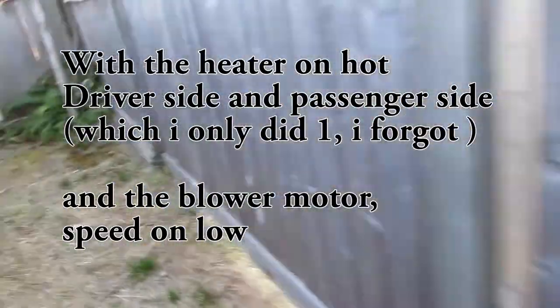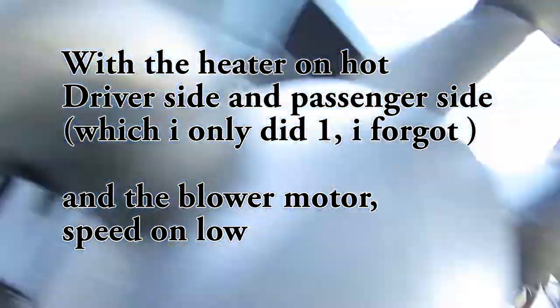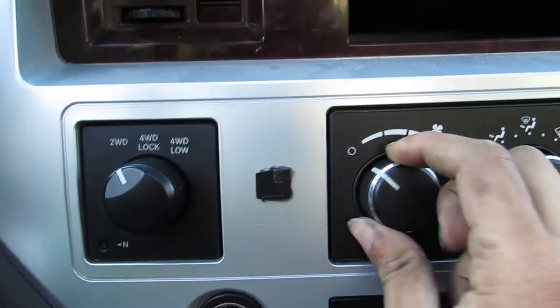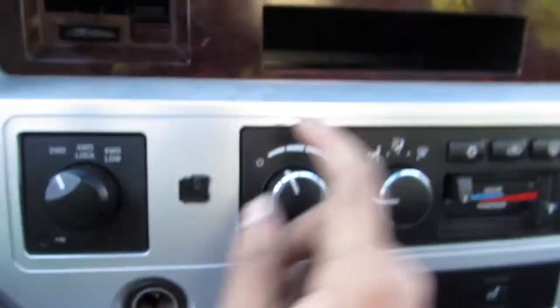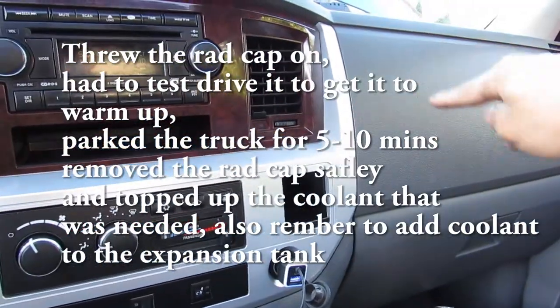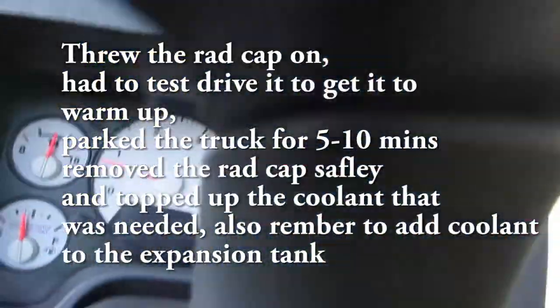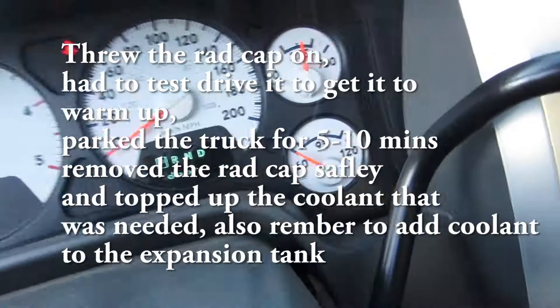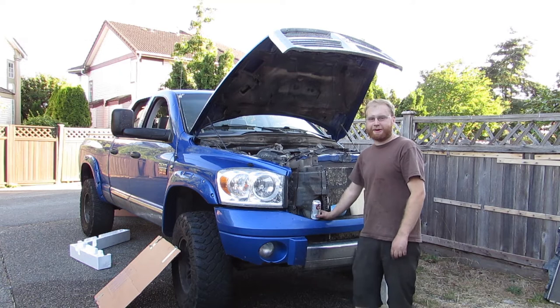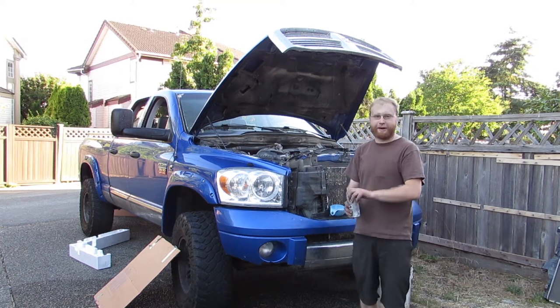Go inside and put your heater on — actually I'll show you guys how to do that. Sounds like a tractor. Alright, so heater on max. Turn off the AC — you don't want to be on any defrost, so face only, and fan on low. Because if it's on high it's going to cool it. With the heater on and the fan on it opens up the heater control valve, so it lets the coolant circulate in the heater core right here. Instead of getting blocked off, it's allowing coolant flow, which we need. We're going to wait for the coolant to get up to about operating temperature and we want to feel hot air coming through. We're currently burping the radiator but we got it back running again — hopefully everything goes well.